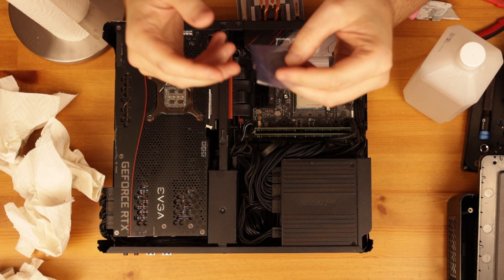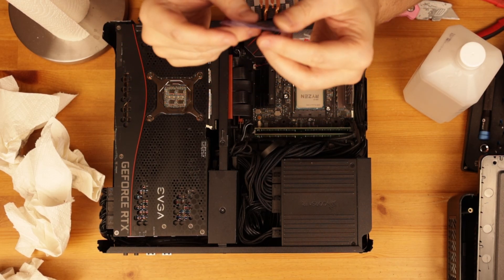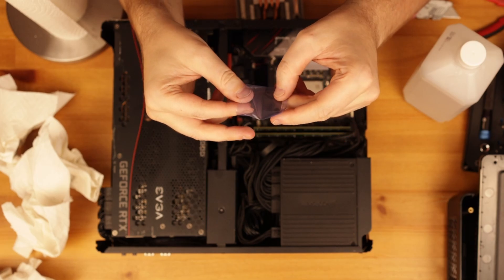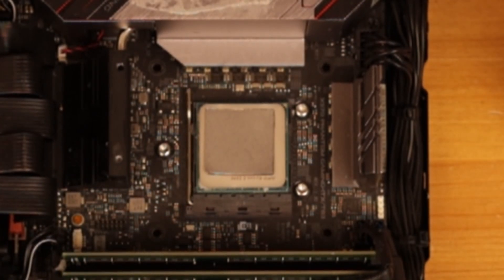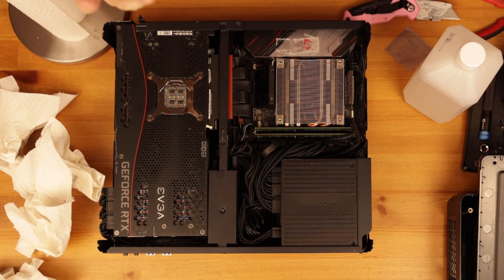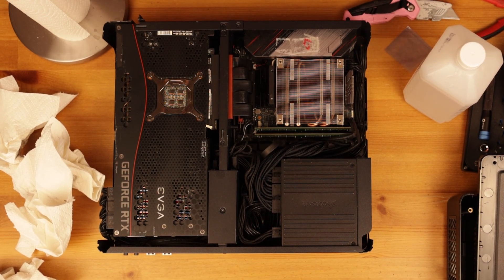I lied a little bit — I'm not actually going to be repasting this chip. I have since come into love with these thermal pads. These are phase change material pads, basically a replacement for thermal paste. You put it — it's nice and thin, designed to go between the CPU and the heatsink. You just put it on, put the heatsink on, screw it down, and as temperature goes up it converts itself to a liquid to allow thermal transfer. As it cools back down, it goes back into the form of a sheet. They are completely reusable — you can take the heatsink off, do whatever maintenance you need, put the heatsink back on with no more goop ever again. They're really freaking awesome, and that's what I'm using in all my rigs now. I wanted to take this one apart so I could just do that once and be done with it forever.